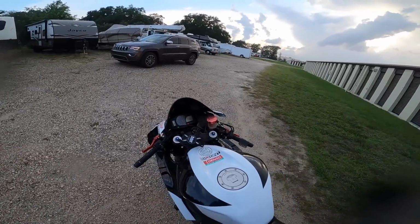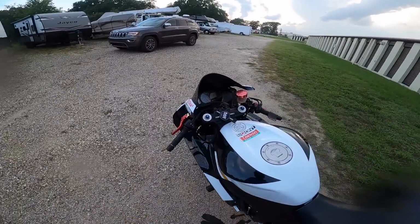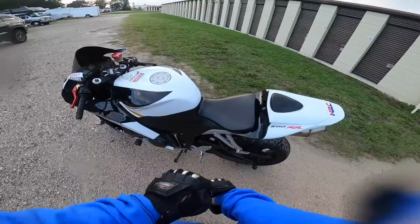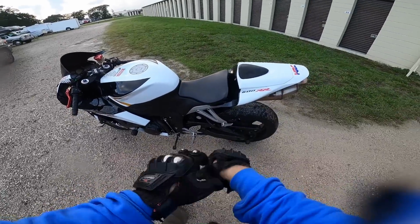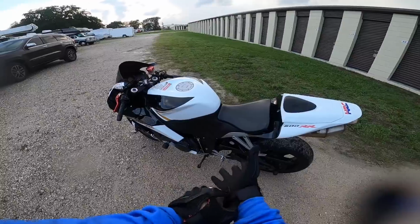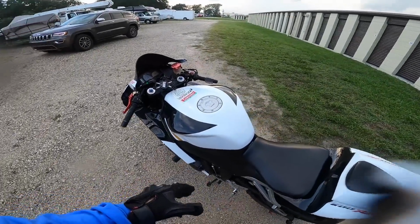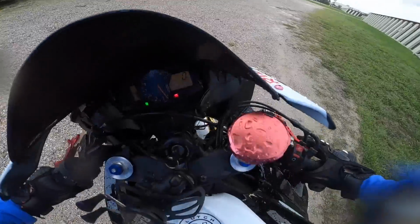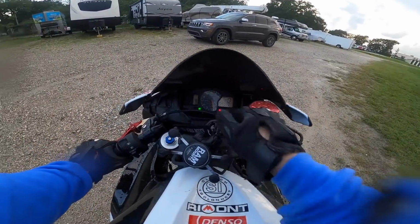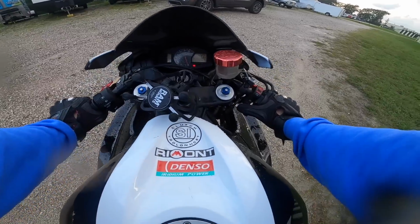All right, so I just bought this bike. I paid $4,000 for it. He was asking $4,500, and it does have some issues. The chain is insanely too tight, and it's actually making a noise. I'm pretty sure that's the only reason it's making a noise, I think it's putting a lot of pressure on the output shaft. And also the triple is kind of cockeyed, and hopefully I can just reset that when I get to the house. We'll see.